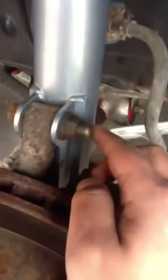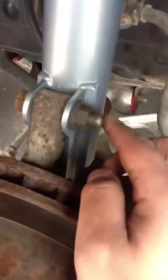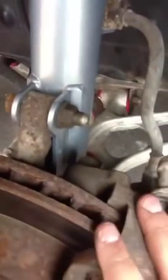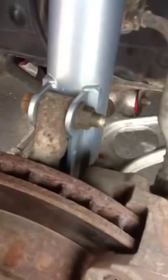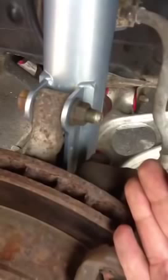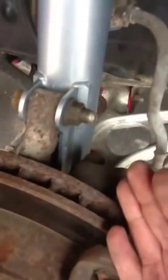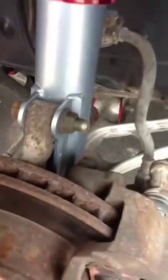One last thing to note for future: always make sure you lubricate your nuts and bolts with anti-seize. If you need to swap stuff again — nice thing about this car, I already did. I put T2 basic suspension on this and I lubricated everything, which made putting this coilover stuff a lot easier. I didn't have to worry about stripping or breaking anything — I just put my impact to it and everything came loose. And so that's it for now.